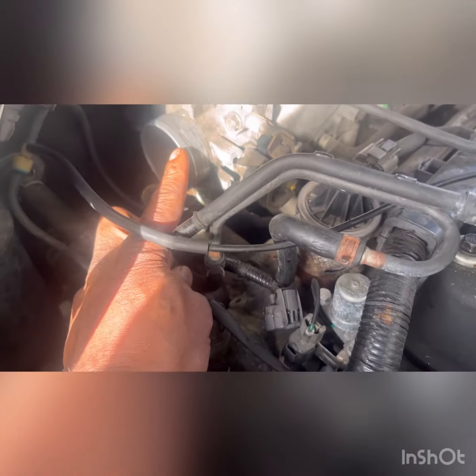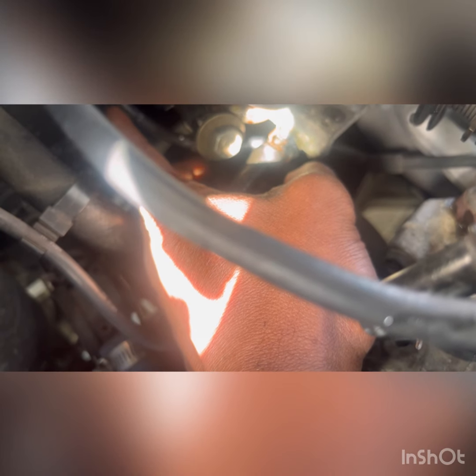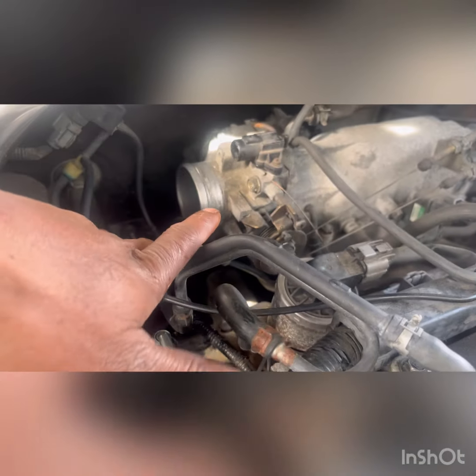Let me bring you a little closer. On the throttle body you've got a couple of sensors — one at the top, one at the back. You've got a couple of water hoses to disconnect: one on the back and one at the front. This front hose looks swollen so we're going to replace it. This other one wasn't clamped at all — if the car had been driven a while, it would've gotten hot and popped off. In the back there's also the idle air control sensor, and I'll show you how to remove it without too much stress.